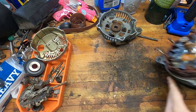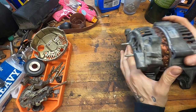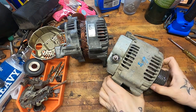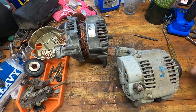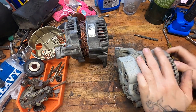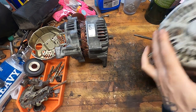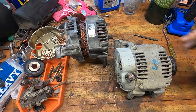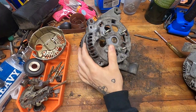I'm going to put it back together enough so that Rock Auto isn't too pissed at me. They want the copper windings and they want the aluminum housing, so they got what they wanted. Now I thought it'd be interesting to dissect this other one — and the reason it'll be interesting is it's completely seized. What I think would be interesting is to find out exactly what's seized. My guess, since this pulley won't turn, is either this front bearing or this back bearing. This Denso is definitely aftermarket.